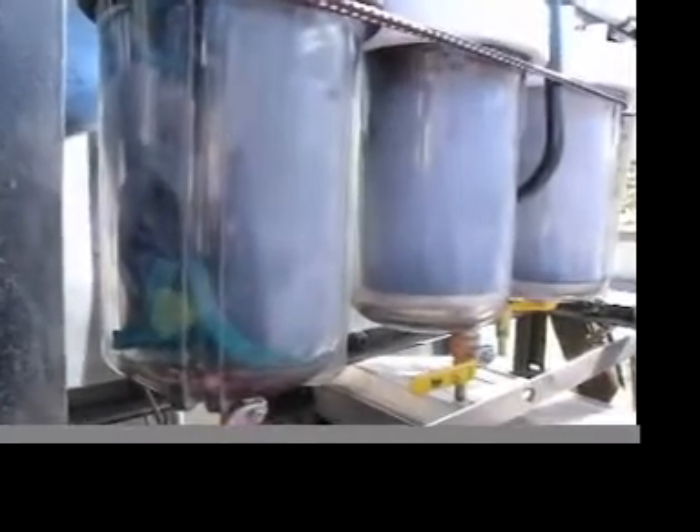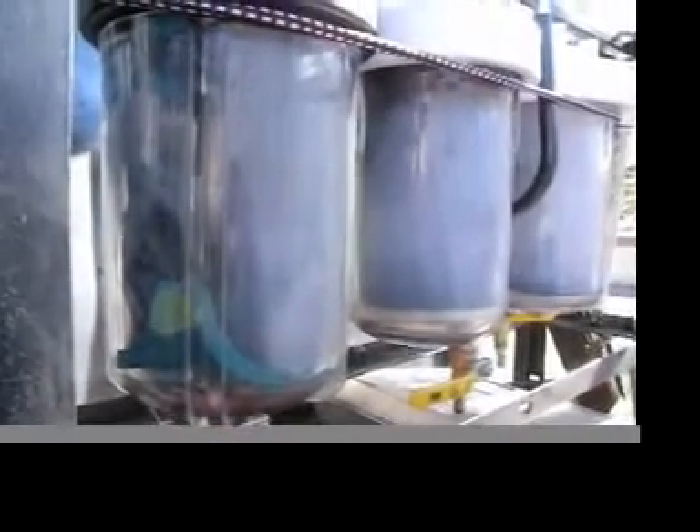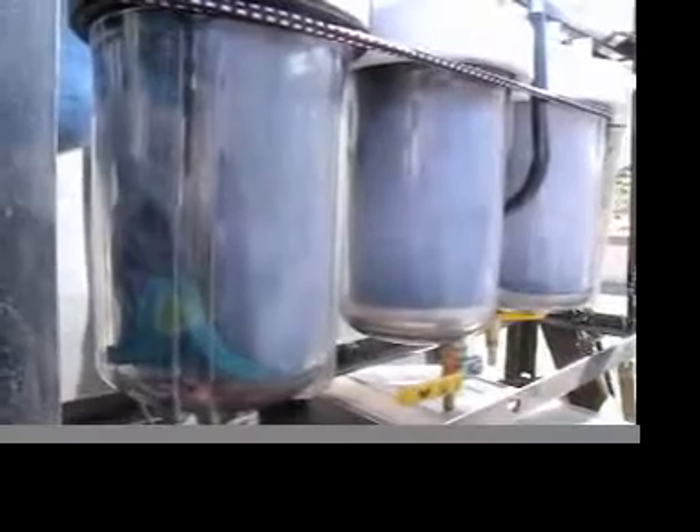You can see it's buckled on the canister. That caused the destruction of the filter, and the same thing happened with the other filter canisters. You can also see that the canisters were fogged, and that fogging was caused by the alcohol in the gasoline.